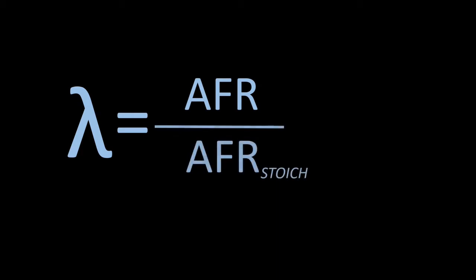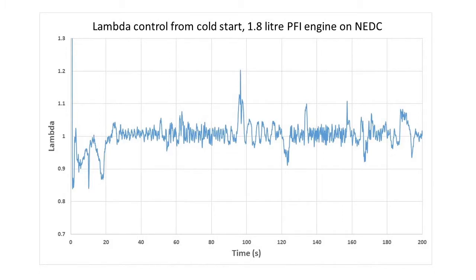What we're going to be looking at is the air-fuel equivalence ratio expressed as lambda, which is the measured air-fuel ratio divided by the stoichiometric air-fuel ratio — that's the perfect burning ratio for this fuel — and this should be about 1. If lambda is less than 1, you're running rich, and the rich misfire limit on this vehicle is about 0.65. If you're greater than 1, you're running lean, and the misfire limit is about 1.35.